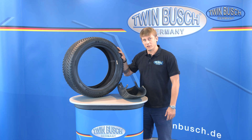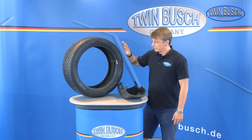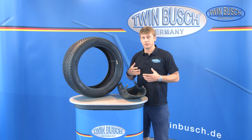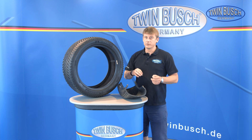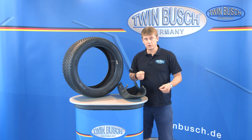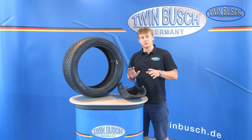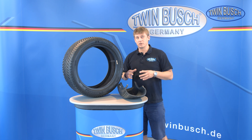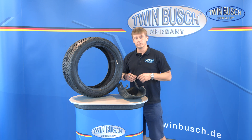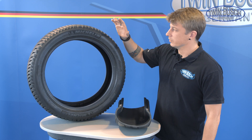To find out whether a tire fits a car, there are many key figures on the tire. The permissible wheel-tire combinations for a car can be found in the vehicle registration document, but not all authorized combinations are listed there. There are additional COC papers which can be requested from the manufacturer or found online. For special tires or wheel-tire combinations not in the authorized list, you can request a revision and get a certification.